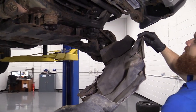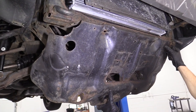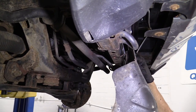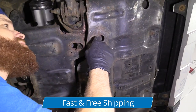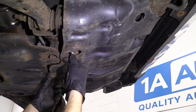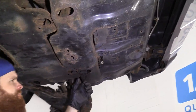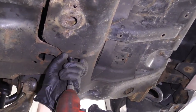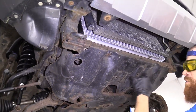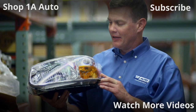So we've got our skid plate. On the skid plate you've got a little hook here and one over there — they go up inside these grooves. You want to have it in the downward position, line those up with where they need to go, then swing the skid plate up and give it a loving bonk. Use the 12 millimeter socket to get the bolt lined up with its hole — that one's started, do the same to this one, right up inside this slot. Tighten those up. If you had the other two bolts that go in up front, you would replace those as well. Thanks for watching. Visit 1AAuto.com for quality auto parts shipped to your door, the place for DIY auto repair. If you enjoyed this video, please click the subscribe button.